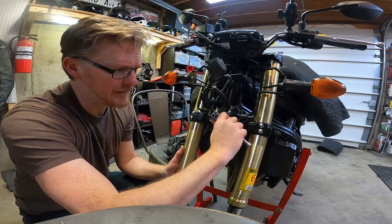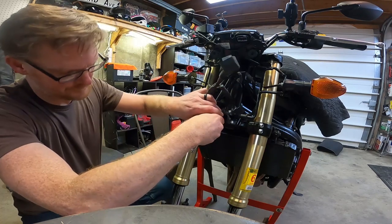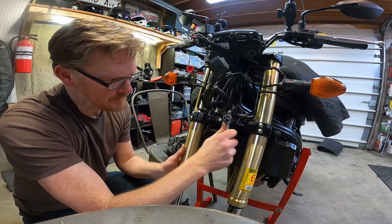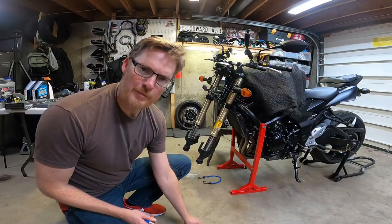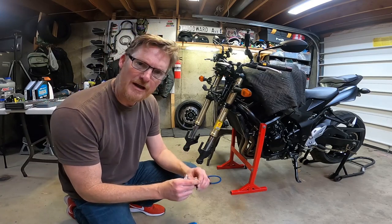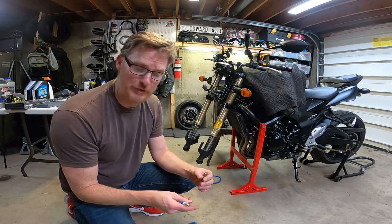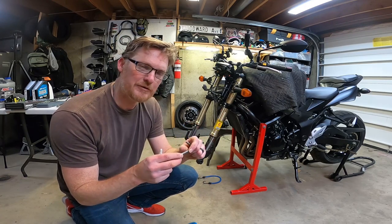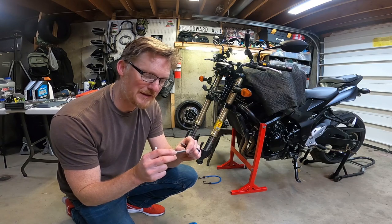And I'm not doing a specific torque setting. I'm just doing them taut, not tight. It doesn't need to be that tight. About there. There. About there. There. So if you remember, I had a stripped bolt on this pinch clamp down here on the bottom of the fork. So I beat it up and was able to get it out with a bolt extractor. However, the old Allens were ruined, so I found some locally. And funny, to find the exact same length, I think it was 35 millimeter, was impossible, but these are 40 millimeters. So they stick out of the back 5 millimeters, a little longer.